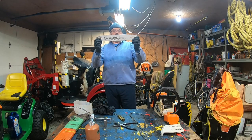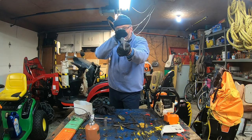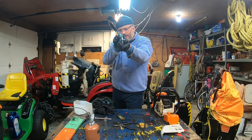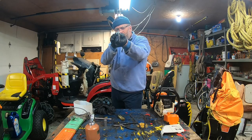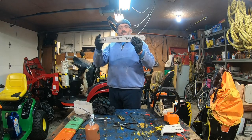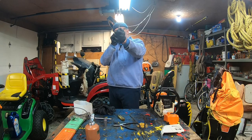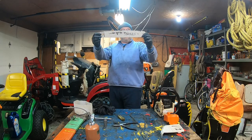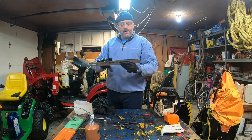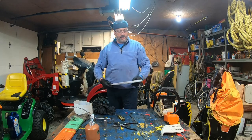At the end of the year, that's why you're going to check if your bar is straight. Like both sides of the lip of the bar are straight. So mine are pretty good, okay? And the reason is to make sure the top and the other side are wearing evenly, so you do take the time to look, okay? And right now I can tell that this side has a little bit more wear, so I'm going to flip it like this, so it's going to be inverted this time, okay?